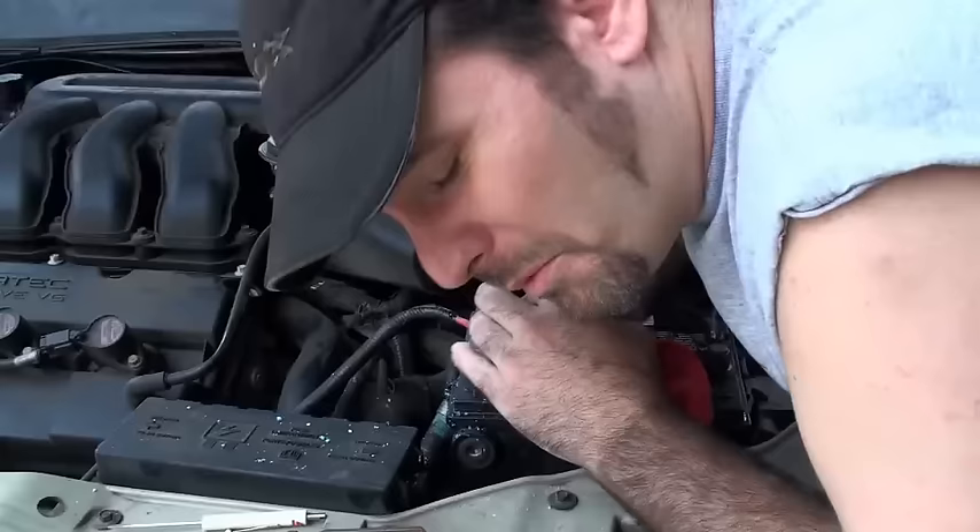Hello and welcome to yet another quick tip from Eric the Car Guy. Today I'm doing a video response to my good friend bowling ball out of heaven, who asked me about a sticky throttle on his Saturn. The number one cause of this is basically a gum up or varnish that builds up around the throttle plate itself, and as it tries to move it gets stuck, so you get that initial hard push on the pedal. Here's a quick and easy way to take care of that problem.